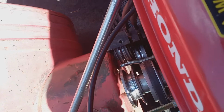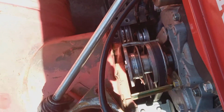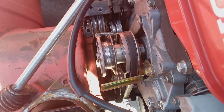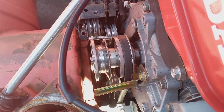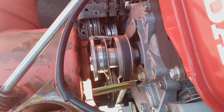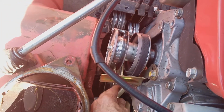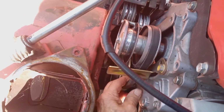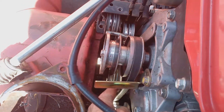The cable's not broken. It's working the tensioner, the wheel to engage the belt. I've already checked the belt. Most of the time, when the machine won't drive, if it's not the engaged lever, released or engaged, it's the belt. Usually, it's the belt. So, don't panic. Just take off the belt cover, which is really easy. Check your belt. Make sure that the key's off, and pull the boot off the spark plug. You see, I'm turning the belt, and it's turning okay. It's not broken. If it's broken, you'll know it, of course, and it's not too hard to replace.